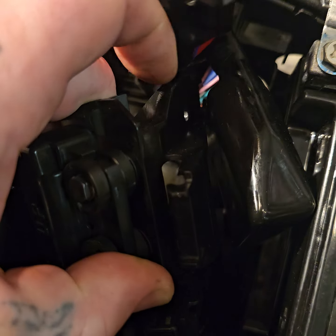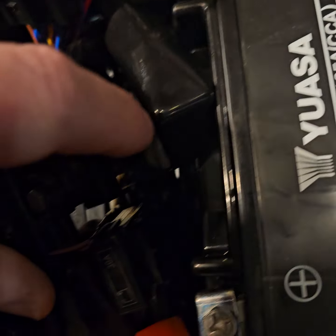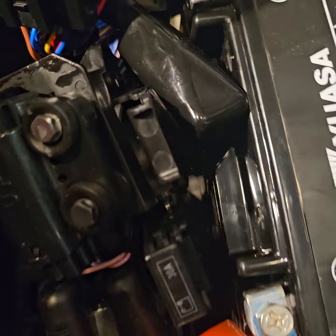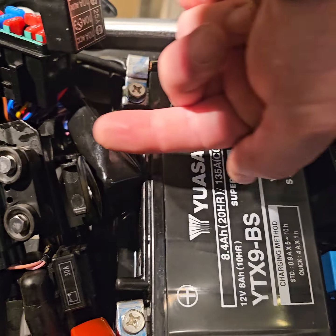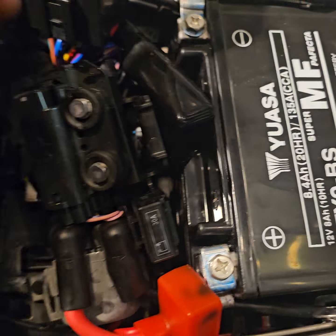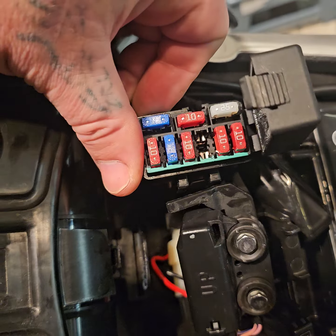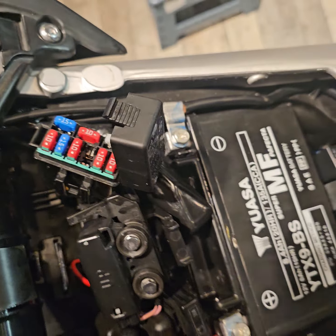So this bracket has two screws. Star Torx T20s, and they're down there. They're sort of screwed in this way, so the battery does have to be removed to get to them. So I've done that, but then I've found I've got to put the battery in to find which one the positive is.